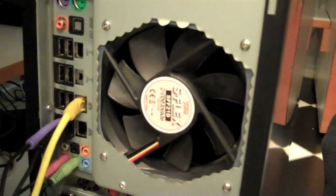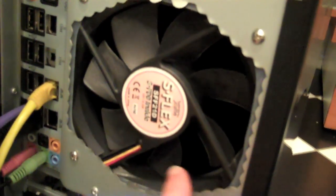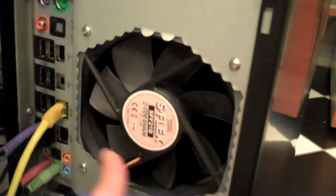As far as other methods for reducing fan noise go, a rather important one that a lot of people overlook would be cutting out or removing obstructions at the exhaust or intake side of a fan. Most cases will have stamped steel grills covering the fan, and those will actually produce a lot of noise just from the turbulence they create. Removing those from your case using a Dremel, jigsaw, or whatever you have handy can actually result in a pretty substantial noise reduction. As a bonus, you get an increase in airflow because you're reducing the restriction the fan has to fight against.